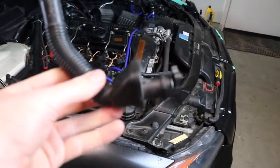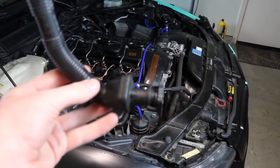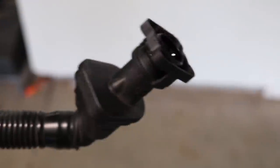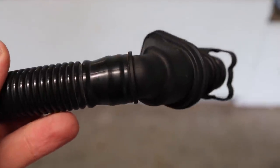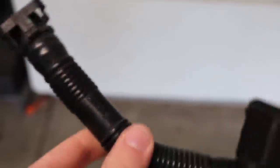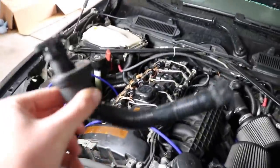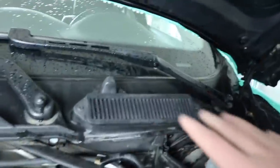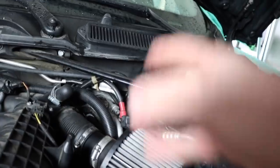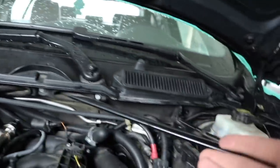The PCV is out. Basically I have to detach this head — it has a valve right there. From what I've seen online and from BMW Fanatics videos, you need to heat this up here. Once you disconnect them from each other you can put it off to the side to reuse later, but you do need this top portion to connect the new hose to it. I see an issue: I took off that whole tray and put cowl filters in, so these wires are kind of getting in the way.